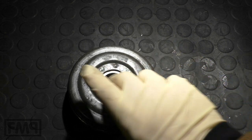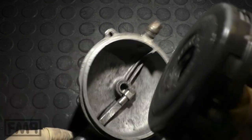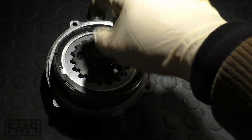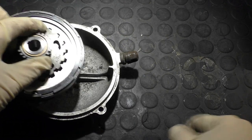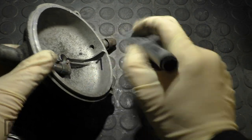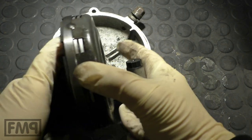What I want to show you is what you have to change at the clutch lid so that this clutch fits in here. As you can see, it does not fit right, because it is a 125 lid and it has this small beam. So the very first thing you have to remove is this beam here — that's number one.